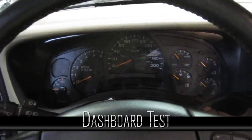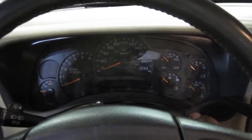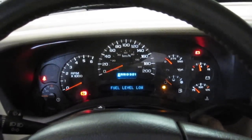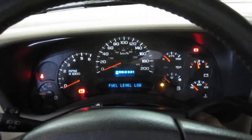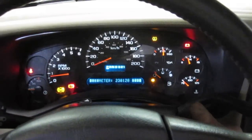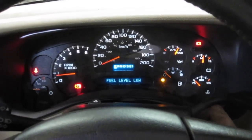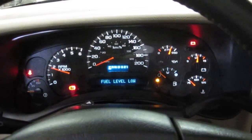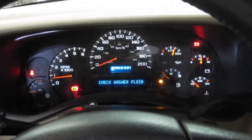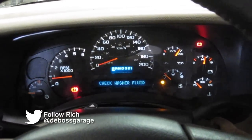I've taken the dash out already and drilled out the service engine light and theft light. I want to see if everything else is still working — there we go, everything came on. Fuel level is low because the fuel tank's not hooked up yet and there's no coolant in it yet. Airbag light went off, that's good. The tach is working, oil pressure gauge is working, it's charging even though the battery light's on. I've got to get rid of that squeak — wondering if it's my alternator. Sounds good.